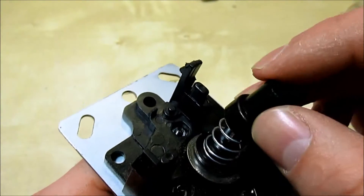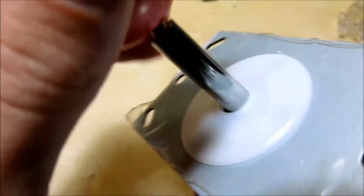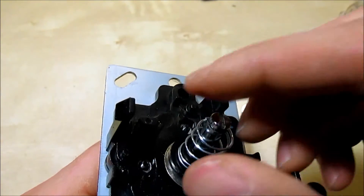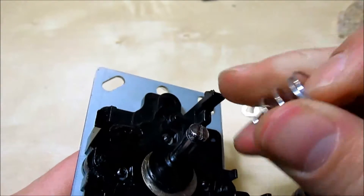The tension of the spring forces the joystick to return to its neutral position. If you like a firmer joystick that requires more force to deviate from its neutral position, you can remove the spring and put two of the same type of springs in here.